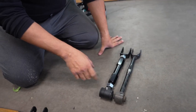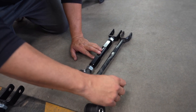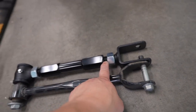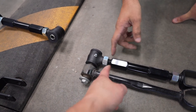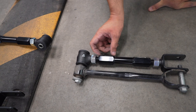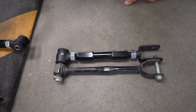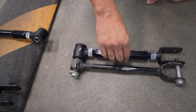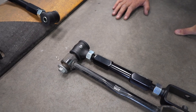So let's get the first one. It looks like we're there already — we try putting the bolt through and it lines up with both ends. I think any bolt will work as long as they line up. It is important to have these as even as you can, because you don't want one extended all the way out and the other all the way short — that creates binding and it will fail. There will be more stress on one side. So once it's done you want to lock the alignment in and then it's ready to go back into the car.